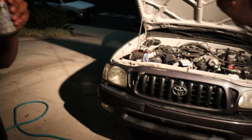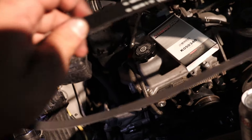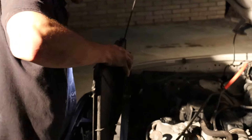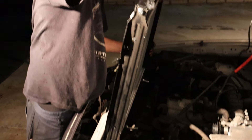Yoda gang! Look at that. The AC belt is a 4K 343, the alternator belt is a K050 340 which is already on there — you got to put them in order. Got it hanging on there just loose, loosen the tensioners a little more and get it over there. The power steering belt is a 4K 425. Tensioning the belt — you want about a half inch of deflection on the long side. Got all the fan bolts tight; back in reverse order for the new radiator.